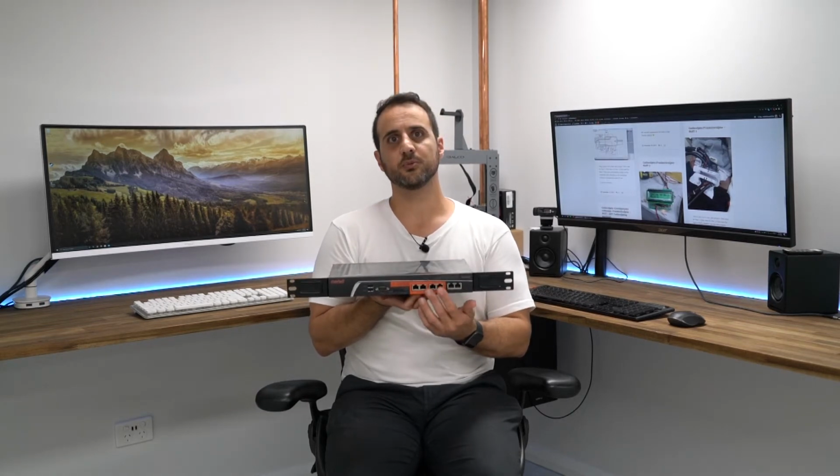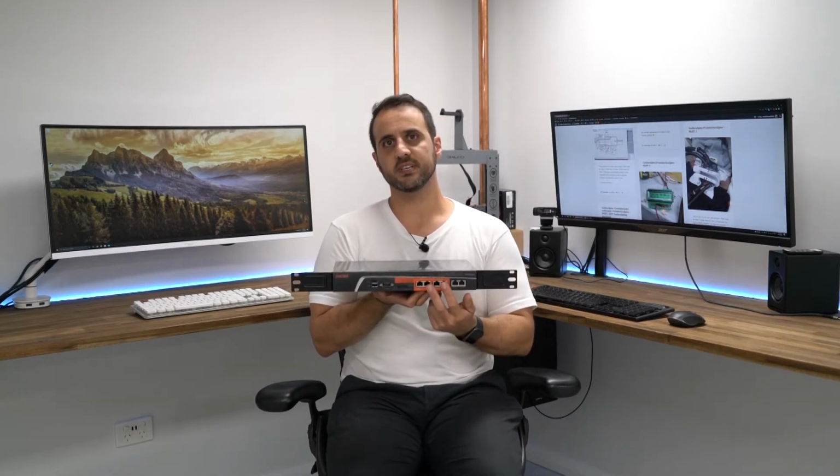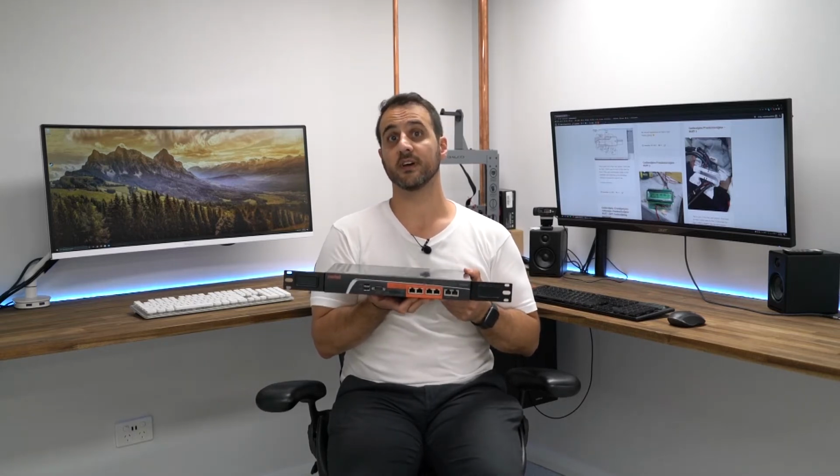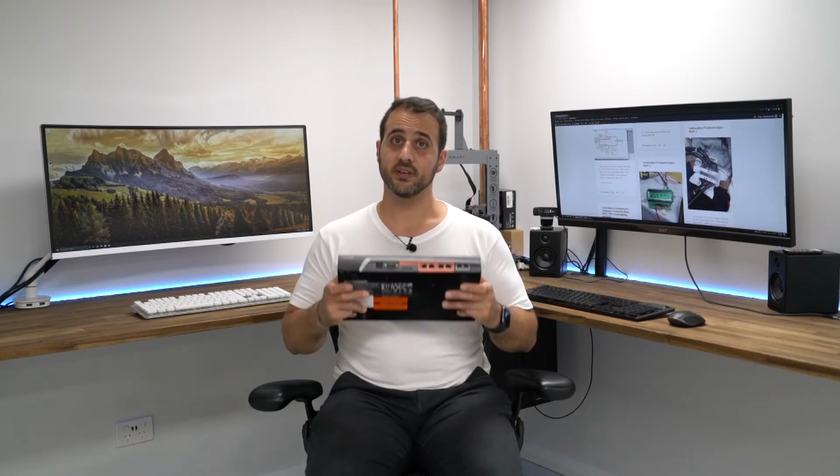There's 2 normal interface ports, the primary and the auxiliary, and then there's 2 pairs of Inpath ports. We're going to turn these Inpath ports into just normal ports, and so then you'll have all 6 of them available to you. In 2016, I hacked one of these devices, but the only way I knew how to was by desoldering a few bits, adding an Arduino fan speed controller, and a few other hacky things. The project was documented on my blog, and I received a lot of feedback from the community, including on how to do it better. So this time around, I plan to hack this same Steelhead device, but without any soldering and without an Arduino. So let's get started.